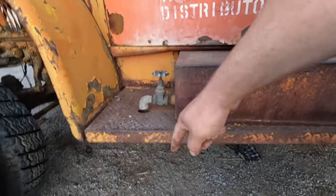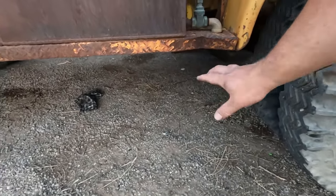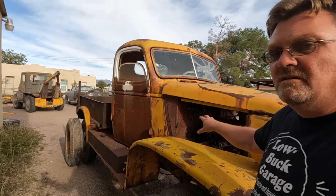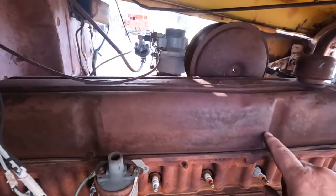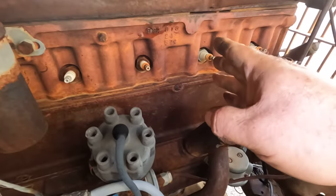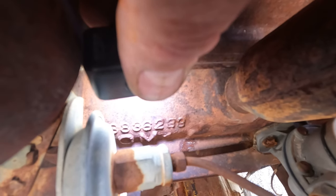You guys told me the answer on these drains that point straight down — this was some kind of service truck. They'd fill these tanks with gas or oil, and when they needed some to service another vehicle, they'd put a bucket under and pour it straight down. Now before buying this, I did at least 7 minutes of research on the internet and found that if it was really a '49 it should have been a Babbitt bearing, splash oiling, low-pressure motor. But the valve cover is bolted down here, not through the top — there should be two holes in the top of the original motor. The head also looks like a different color than the block, so this motor might be a complete mutt, pieced together from different motors. I think I found the actual casting number right next to the distributor: 3836233. Let's figure out what that is.